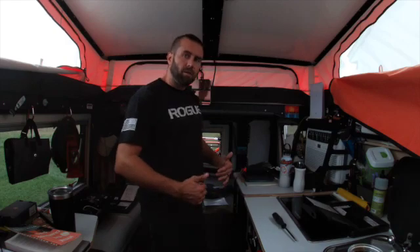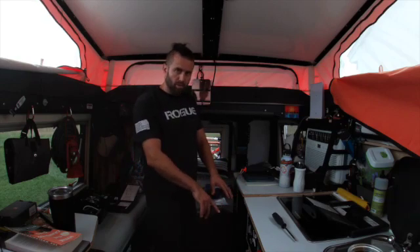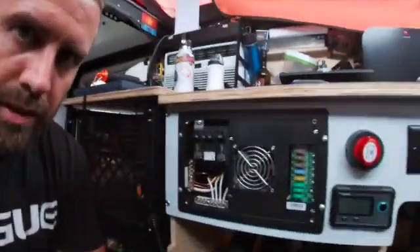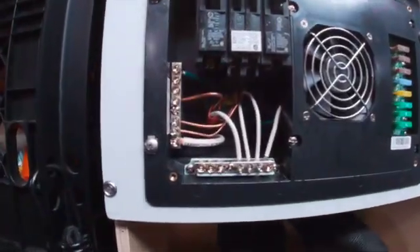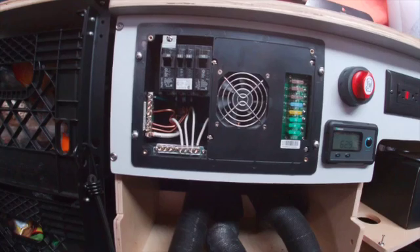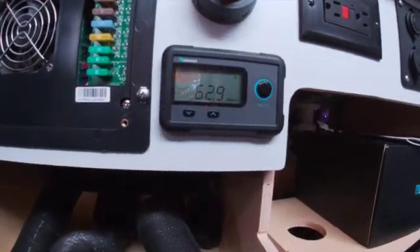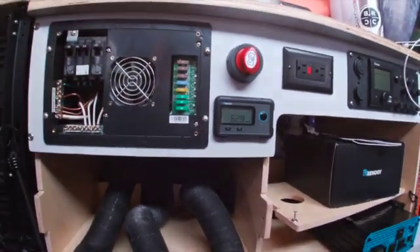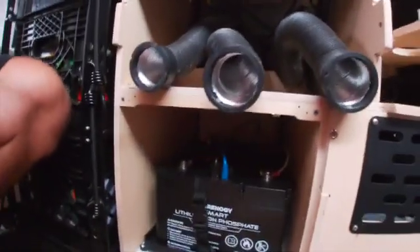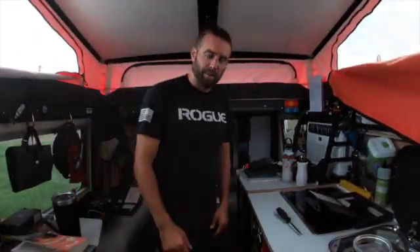Now I'm going to bring the panel out. Key tip: if you're able to do this yourself, take a picture of how the wiring goes to all the breakers — it's going to make it a lot easier when you go to put things back in correctly. You can see where my grounds, commons, and powers are all going. We'll pull that out, check our 12-volt, and make sure everything gets wired back in properly. You can see a sneak peek: there's my Renogy battery monitor system and I've got two 200 amp-hour lithium batteries down here. Next video I'm going to figure out where I'm putting my inverter and charge controller for solar.